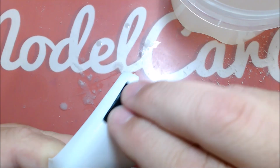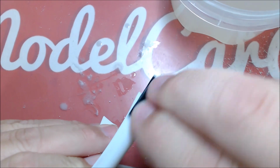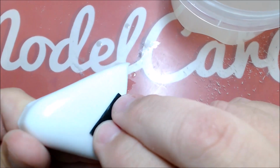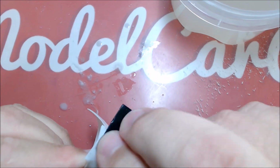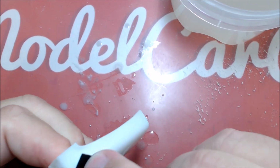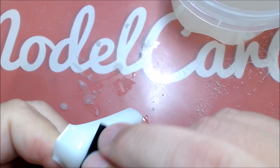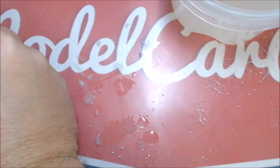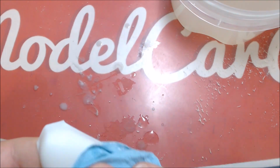That's my finish sanding. So I'm going to do it like this. This one didn't have any hard scratches or anything like that in it. We're just getting it back up to a nice smooth surface. So we got 400, 600. I just like to wipe it down and get all that sanding dust off.